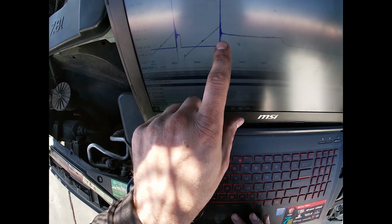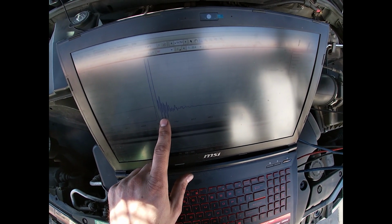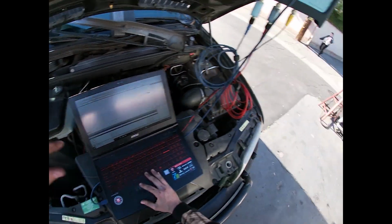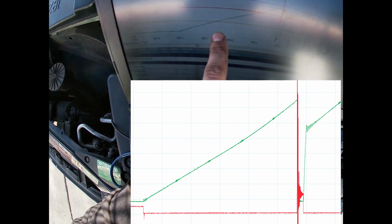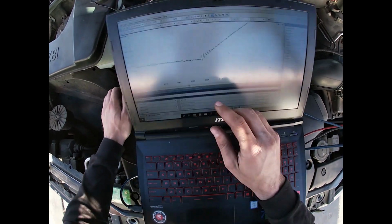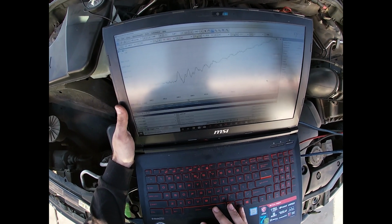And then this, you got some oscillations right here. I will give that some credit, but it used all of its energy and there's nothing left over. So it's a weak coil, and surprisingly it's not shorted. Green looks fine on that one as well as this one. See how this one has the turn on oscillations? They're pretty nice.